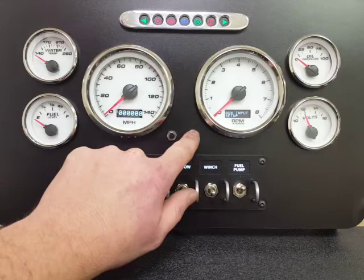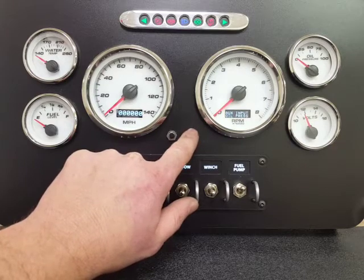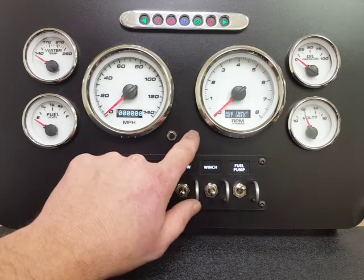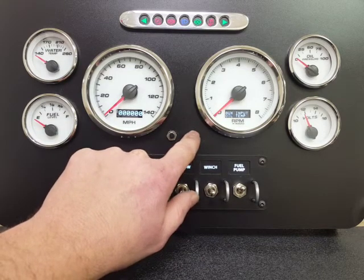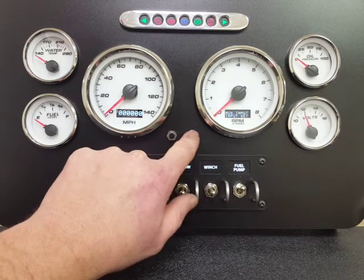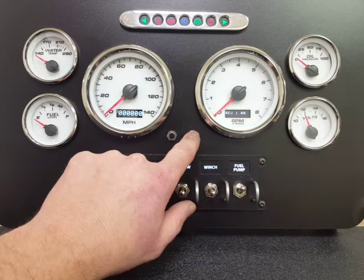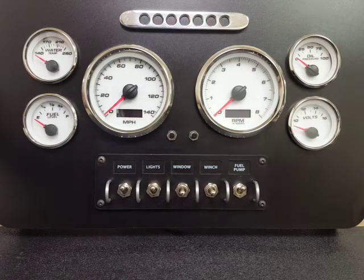Here are your auxiliary inputs — there are actually two of them in the tachometer. You can have it set to not used, oil temp, trans temp, water temp, oil pressure, fuel pressure, boost, or shifter. We also have a shift input driver, which is pretty cool. Plus, we can custom program for you very easily whatever you want. That first input and second input each tell you what rev you are in your system. So it's very, very easy to set up.